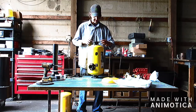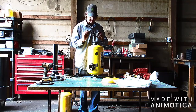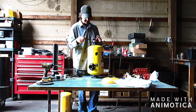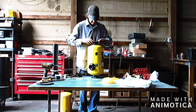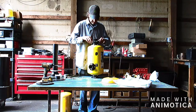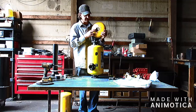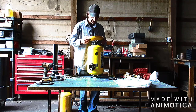Next piece is your grate and grate damper. Now, how you orient it is up to you. Since I got the bracket facing me, I think I'm gonna point this outside, 180 from the bracket. Then your next piece is the clean out. And then the base. So I used the 2 3/8 hole saw to cut the center out. And align that with our holes.